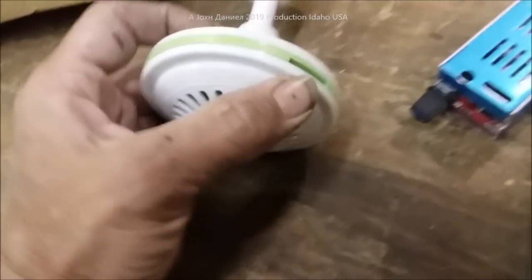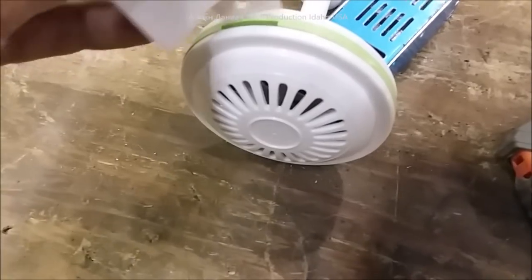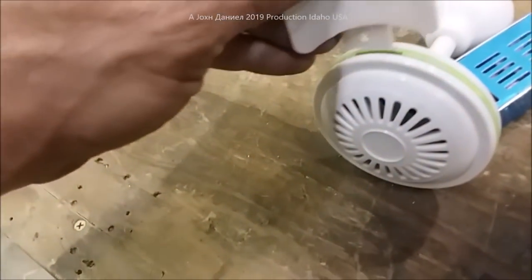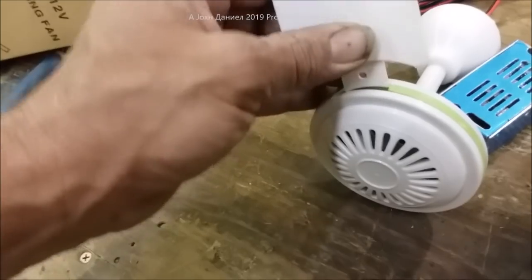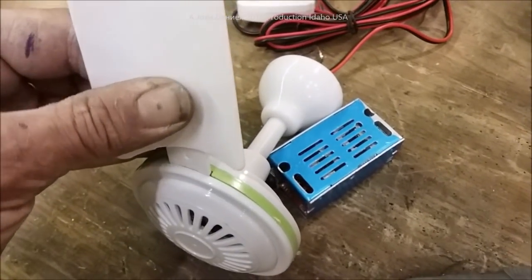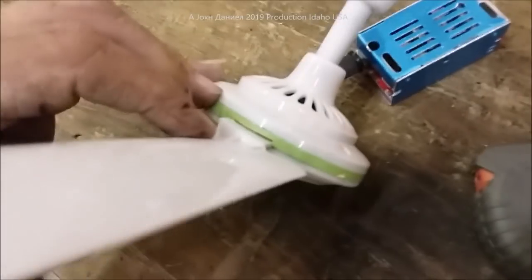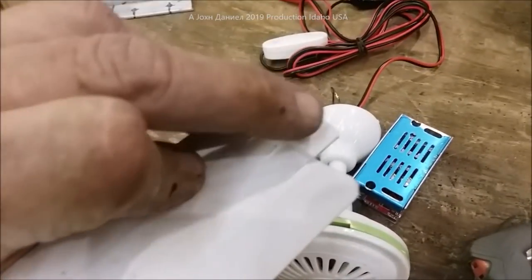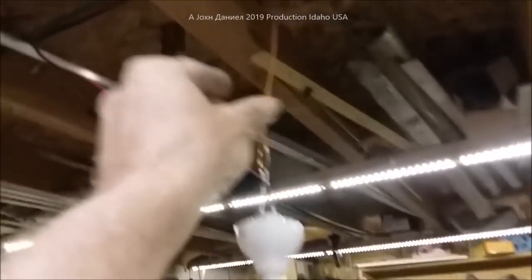Here's the little motor, and you do not take anything apart. The blades literally just snap in. Make sure the back of the blade — the side where you see the 500mm marking — is the part facing you when you install it. They will snap in. You tip them up toward the shaft, then roll them down and they pop in. To remove them, just wiggle them out. They hold well; they have a spring tab, and the fan is very balanced.